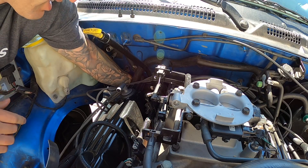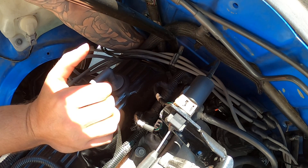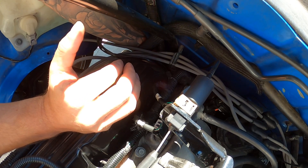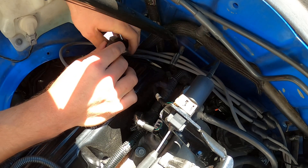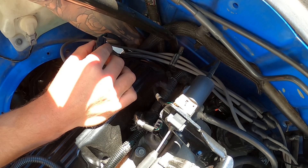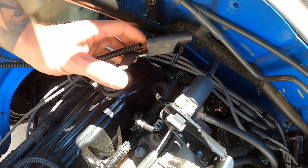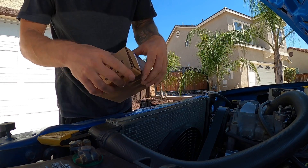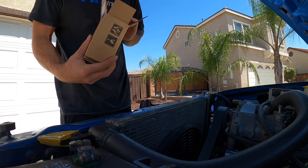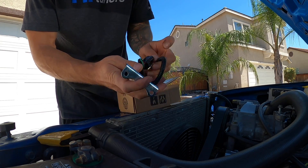The sensor — you might have to manipulate it a little just around your dipstick, but it will rotate out. What I like to do is pull your wire across so that your wire isn't stuck on anything, bring it across so you can visibly have it over here. Then with your wire on this side, you can just finagle it — you're going to have to do a bit of a rotation to get it out. You'll see what I mean because you're going to end up hitting the dipstick tube a little bit with the sensor, and then out she comes. So here's the old one. Here's our brand new Mopar sensor — I'll link this in the description below. It was about $80 with shipping, so it wasn't too bad. Brand new crank position sensor from Mopar.